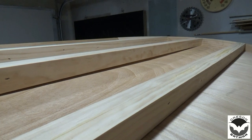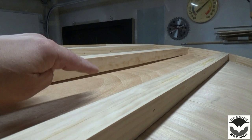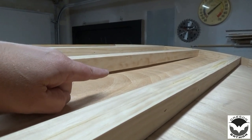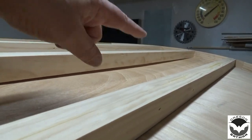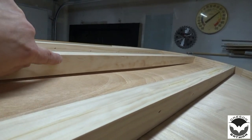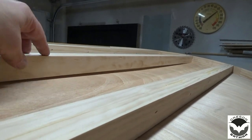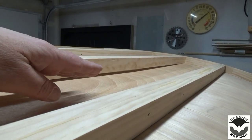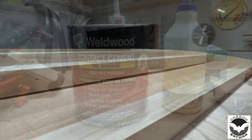Now, for these spars that have a large gap underneath, because this ceiling is pretty flimsy, like I said, it's 1/8 of an inch thick, what I'm going to use is contact cement. I'm going to mark where my spar lays out, then I'll put a coat of adhesive on both the spar and the ceiling, and once that's cured, I will fasten the spar down, and then I'll push the ceiling up, and that's going to make contact and stick on there super solid.